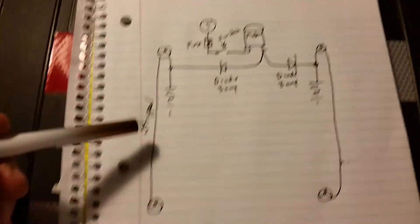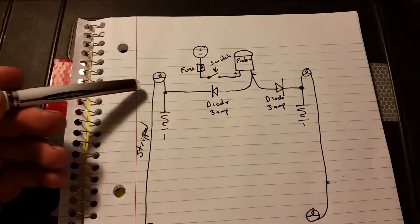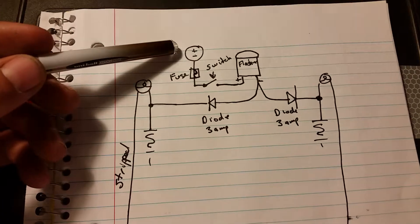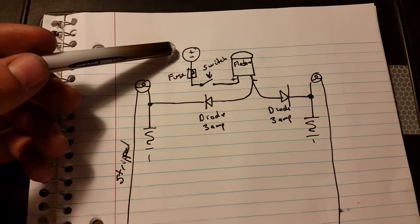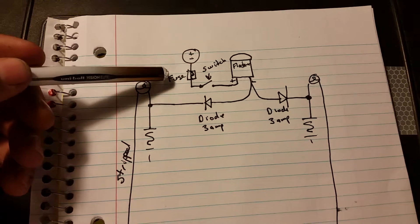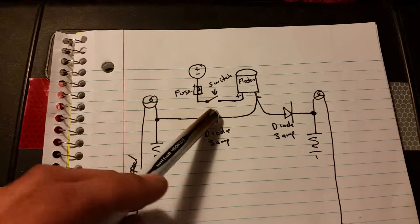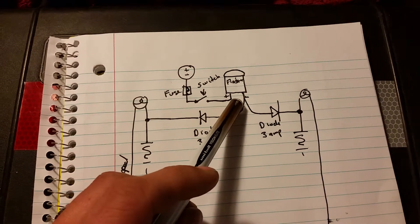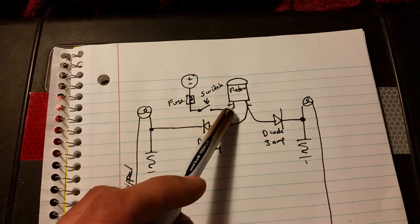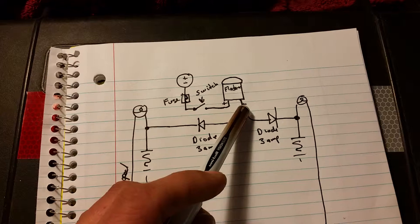I'll show you a crude schematic that I drew out. So here are your four taillights and turn signals. Start up here — this is either a hot wire from your battery, or I actually took a hot off of my headlight relay, which is fused before that. But if you do go straight from the battery, you'll probably want to put in a fuse just in case. And then we have just a simple switch — this is the one in the dash. And this here is a flasher relay from AutoZone. It was I think $11.99, just a mechanical two-prong relay. You've got a positive side that you put your positive voltage into and then a negative side which is your output that flashes.